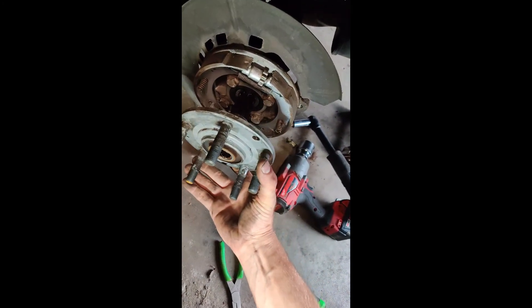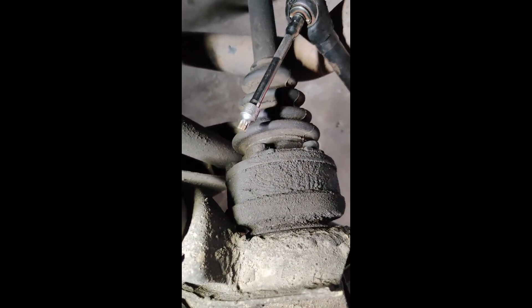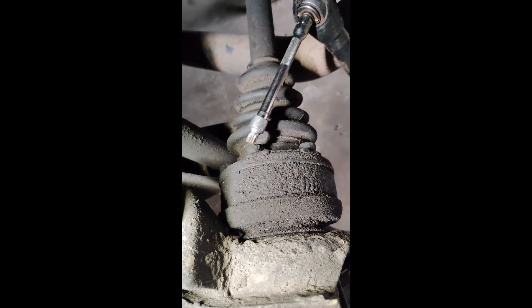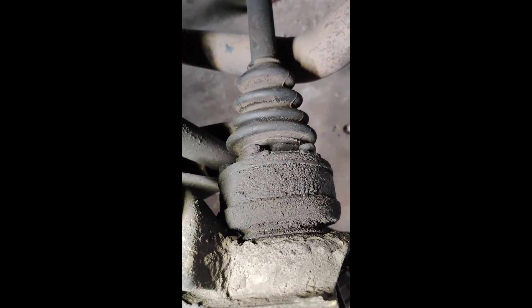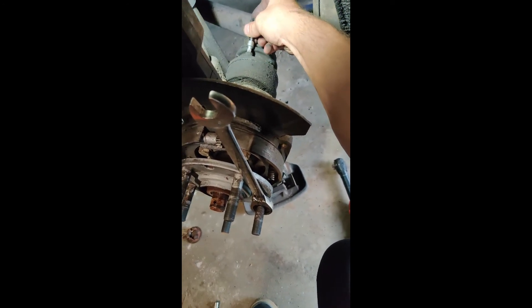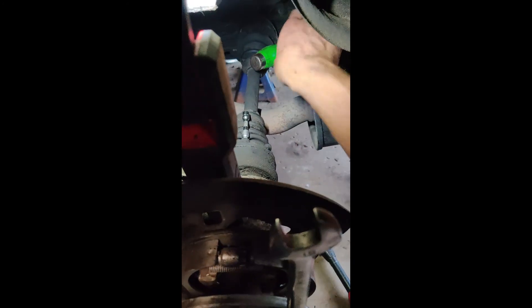You might have to also install the axle bolt again. We're going to take the axle shaft off — it's an 8mm triple square. There's a couple of bolts all the way around there. A good idea is to hammer them in and make sure that they're seated all the way so you don't strip them out.